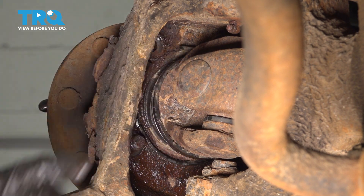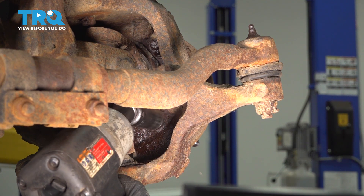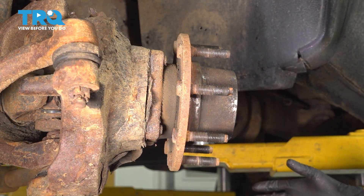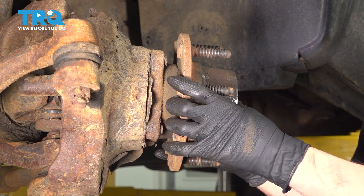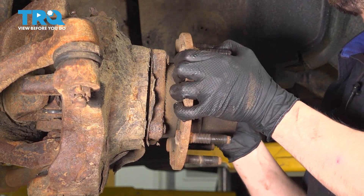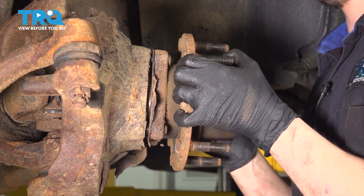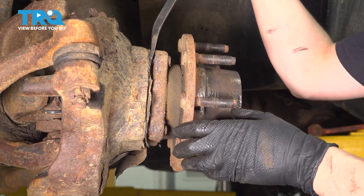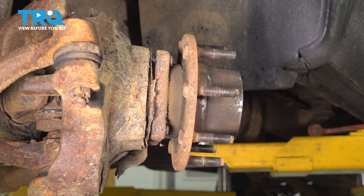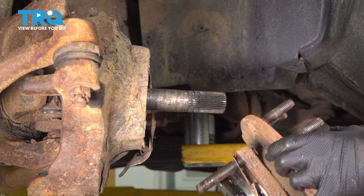Let's turn the knuckle around, go to the other side and do the same thing. At this point the wheel bearing should come out — whether you need a hammer or not will depend on your situation. Although this one's fairly rusty, it is not seized, so that's great. I'm going to have to push the axle through while pulling the wheel bearing out. Use a rubber mallet to tap the axle. You can also use a pry bar right here to pry the wheel bearing off a little bit further. There should also be a backing shield of some sort here — mine is long gone. Slide this out and there's your wheel bearing.